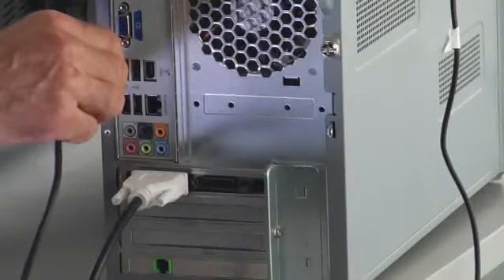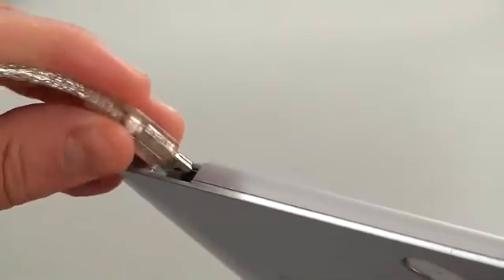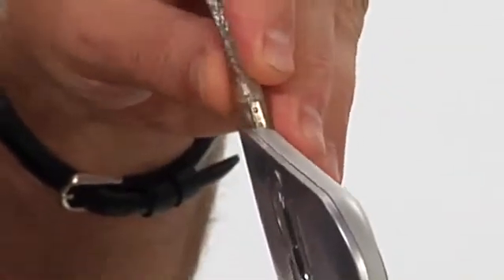Now let's get your tablet connected and powered up. Take the USB cable that came with your BambooFun and connect it to any open USB port on your computer. A direct connection between your BambooFun and the computer is optimal because it provides stable communication and power to your tablet. For the sake of testing or support, this will be one of the first questions we ask, as frequently hubs and docking stations will fail to provide adequate communication or power. The other end of the USB cable goes into your BambooFun tablet like this. Be sure that the plug is pushed all the way in. In many cases, it will resist about halfway and until you get a good connection, it's unlikely that the tablet will work.